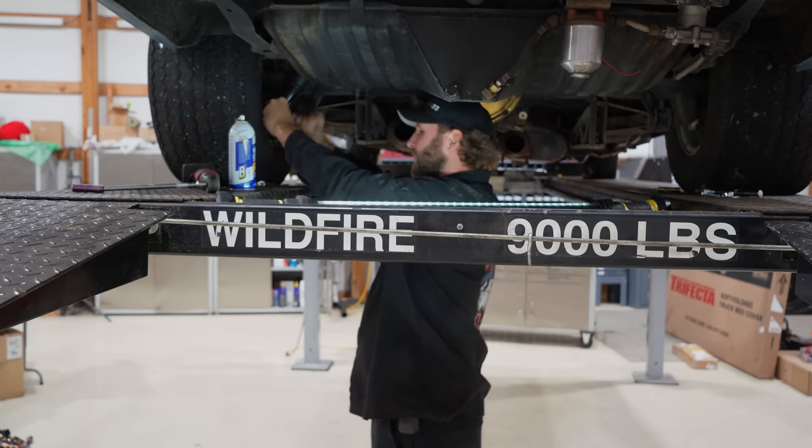Now I can move on to this guy here. I'm gonna disconnect this, pull it out of the car, cut that, splice a piece in, put it back in. We're not running a ton of fuel pressure, but a guy did go on ahead and flare these out. You know what I mean? And make sure we're not gonna have any fuel leaks or fuel fires. That would be nice. Fuel line's all finished up with the old Bendomatic in here. A guy could actually get another fitting and put a fuel gauge under here if a guy wanted to. Probably a pretty good opportunity. This should work just fine for now.